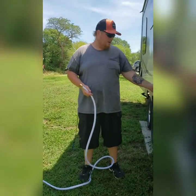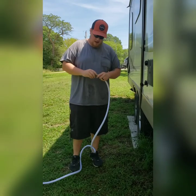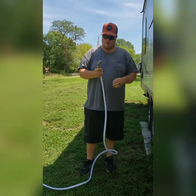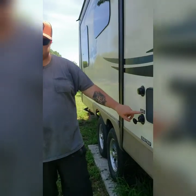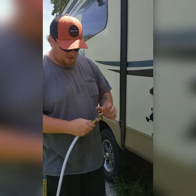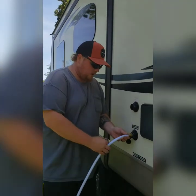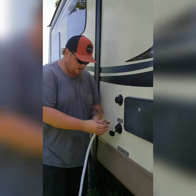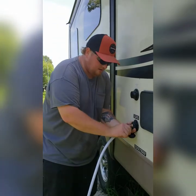We're going to talk about our main water connection. This is for if you have water at the site you're camping at. We do have an onboard freshwater tank on this rig, but we try to camp in places that have full hookups. So here is your city water connection — your main water inlet. One thing we found through a lot of research: get yourself a 90-degree elbow. If not, your water hose with the weight of the water is pulling down on your plastic connectors here and could eventually break. So what works great is a 90-degree water connector that comes down.